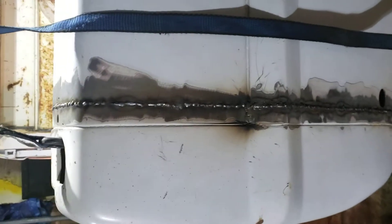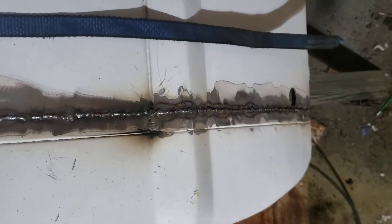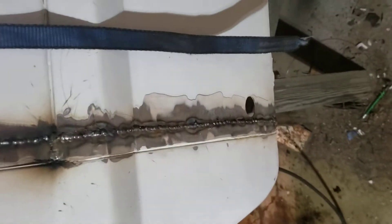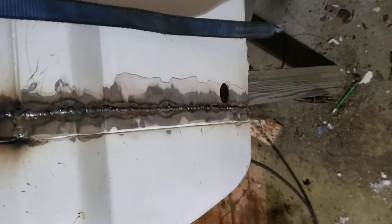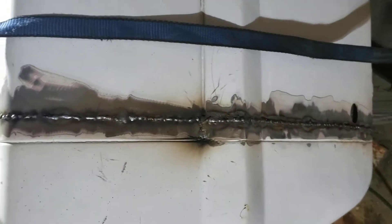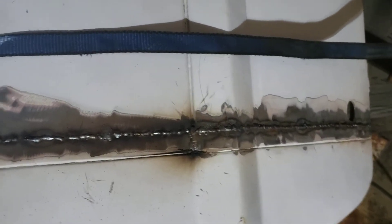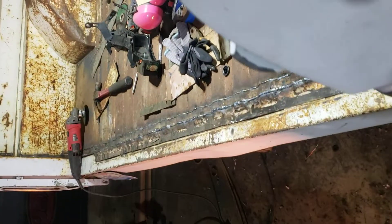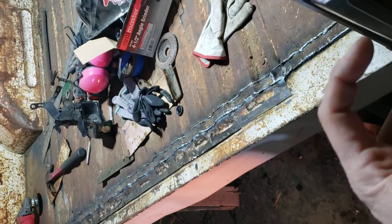On the back side, it's about an inch — the width of the tape — off of that seam, then cut down through. There was a lot of bondo in this one when I cut it back and ground it down, so I gave myself plenty of room to weld. The owner will have to do some bodywork on that — I'll get it ground down as smooth as I can and then the owner will handle the bodywork. Same thing here too, no big seam, because I came back to this seam here.